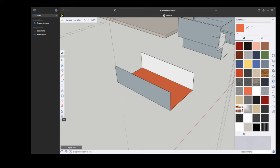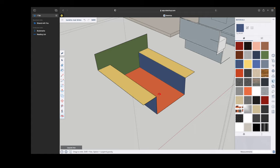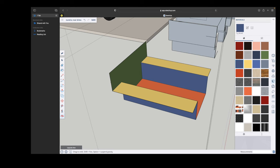There wasn't a whole lot of trimming that had to be done, because obviously the width is 48 inches for the piece that goes into the bottom of the bed of the truck, and then each of the side pieces is cut up 24 inches. So even though I did have to make smaller cuts to get the two 24s, the excess that was cut off was used to do the wings on the side of the tub. And then, of course, I had to use another sheet to do the complete backing, or the backboard. I guess you would actually call it a bulkhead, which would go up against the back of the truck window, or that's where it would sit. It doesn't actually touch, but it's literally just a bulkhead, and it also extends up 48 inches.